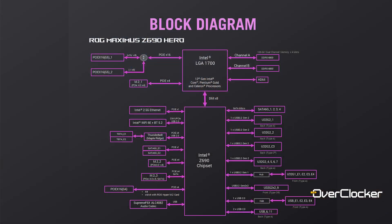Of the three M.2 sockets on the board, two are PCIe 4.0 x4 and the other is PCIe 3.0 x4. I'm not sure why all three aren't PCIe 4.0, but it probably has something to do with all the other features consuming the PCIe lanes on the chipset. This motherboard is packed with a ton of connectivity methods taking advantage of the newfound options that come with the Z690 chipset.